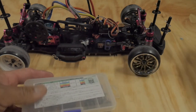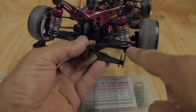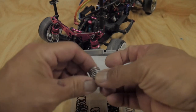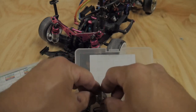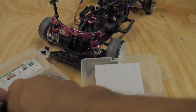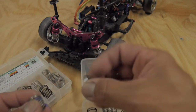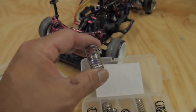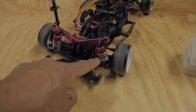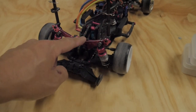Along with this setup, I am using some RC926 springs. For the rear, I'm actually using two different spring rates — a combo spring. I've used this over time with different rates on my D3 counter steer. For example, you can use a combination of blue springs with a ring adapter for two different spring rates. The top springs are way softer, so they start compressing first, while the bottom ones are a little bit stiffer.